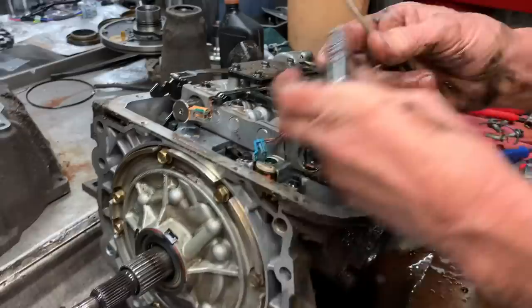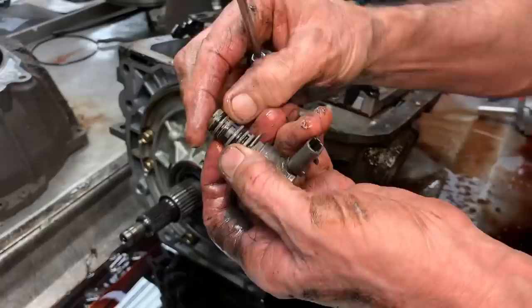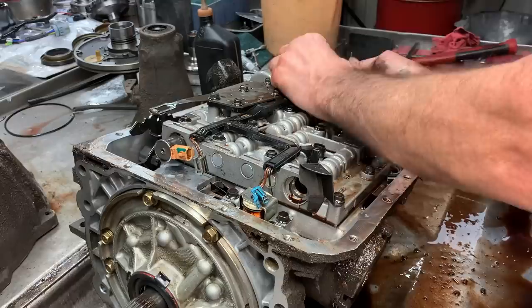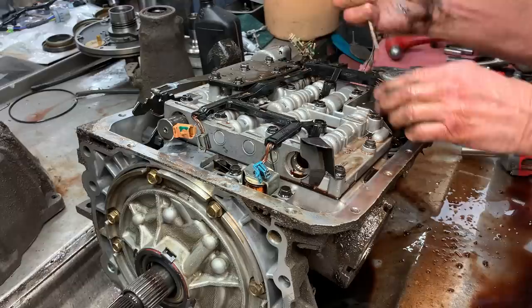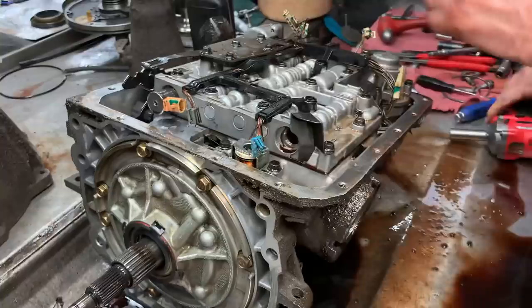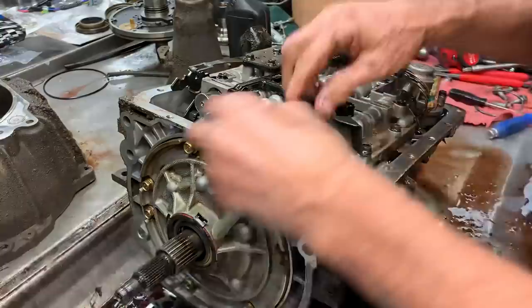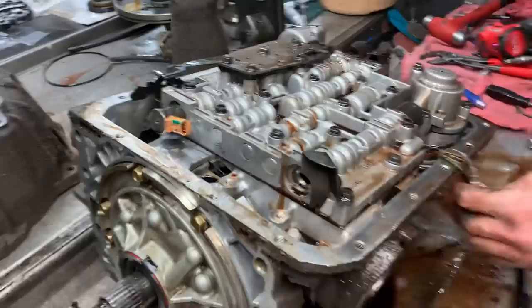PWM solenoid here. These seals get really dried up in all the solenoids. These solenoids hardly ever go bad unless you code it out and see that the solenoid is bad when you scan it with your scanner. Other than that, just change the O-rings and put it back on, because a lot of the new stuff you take a big chance of putting bad parts on there. I actually got a solenoid tester but I broke it the other day — if you ever touch the two wires together even with it not turned on, it will pop it. I'll bring that in and show you guys.